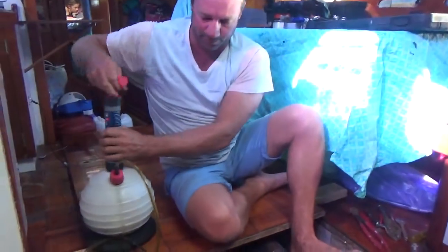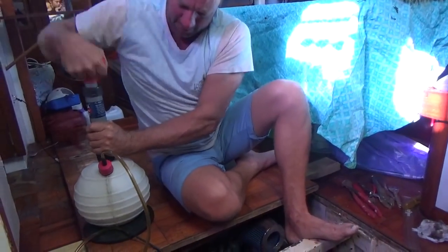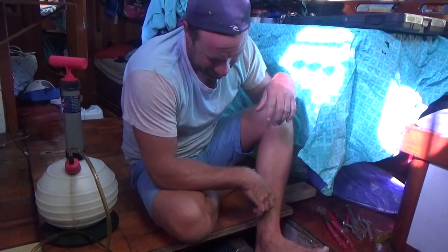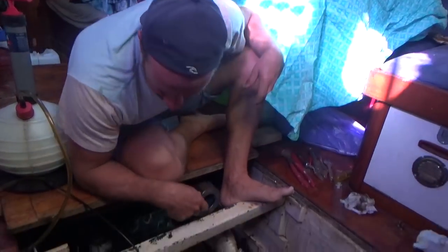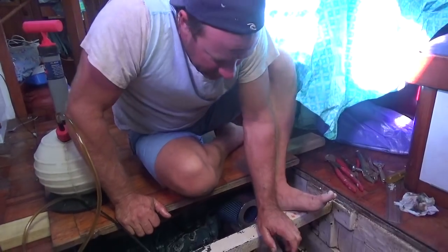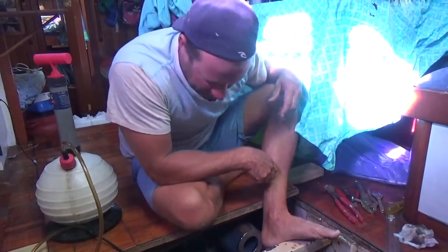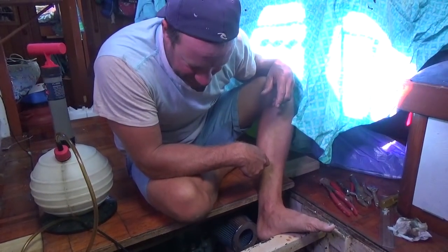So what have you done so far? I'm just in the process of getting 4 litres of oil out, which is another 4 kilos of weight, it all adds up. You didn't do that last time, did you? Disconnected the selector cable, just connected the heat exchange. Just got to remove the spool piece, then hopefully the reduction gear case will come out, and then hopefully get the gearbox straight out. There's a lot of hopefully there.